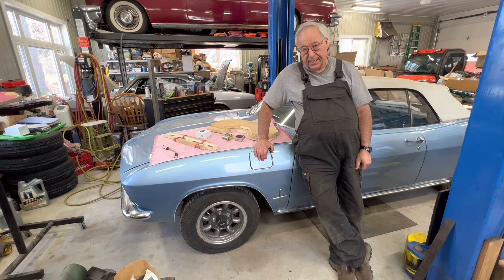The last thing I did was suspension work in terms of the alignment. Needed to do the alignment — the suspension, steering, all that. It needed alignment after taking it all apart and putting it back together. Basically you need to set your camber and the toe-in on both the front and the rear.